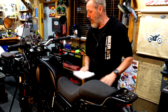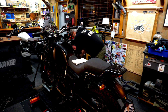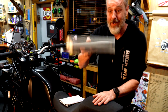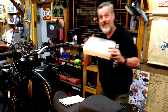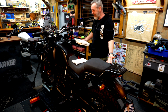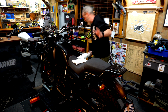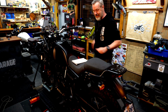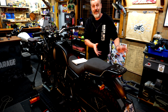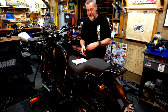Anyway, what I did was, I thought, well, let's weigh it. Let's test it out. And I've got these scales, but you can see I've broken it. It's all right, I have a second one, because how I used to do it is I would lift a bike, have one underneath the back, one underneath the front, drop it down, and then calculate the two to give me my weight. Now apparently they say that the better way of doing it is actually just putting one under the rear, take that out, put it under the front, then add them. So that's what I've done.